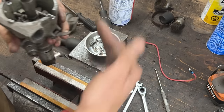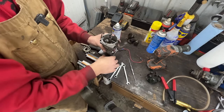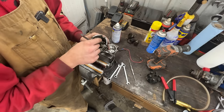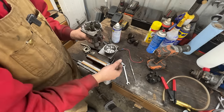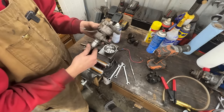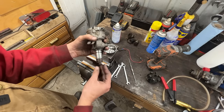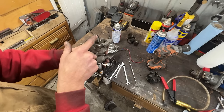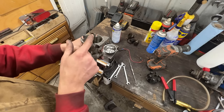So if you imagine that this is the engine here and this is your first, second, third, fourth, fifth and sixth cylinder like this, your first cylinder is normally here, pointing to the front left somewhere. But if you reverse this camshaft 180 degrees, then when you engage this the proper way with your drive gear, then your first cylinder ends up being on this side. So how it normally is, when you look at this key underneath, when you have it to the right of the center, right now that's how it is, and here you have the slot for the key for the rotor pointing to you.